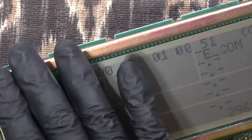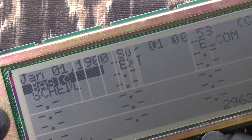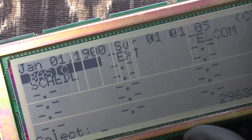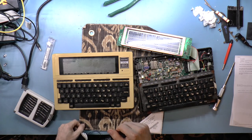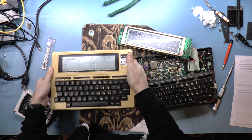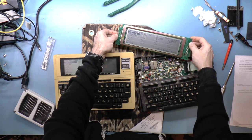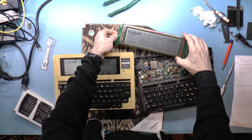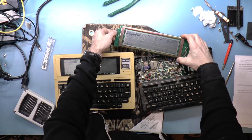Well, okay, so what I can do is remove this again, which unfortunately will cause metal fatigue, and try to line it up properly again. And this time, try to be sure that it doesn't actually move. And actually, comparing this to this working one, I can see that the Y in bytes is actually complete. So in fact, there is supposed to be an extra row, and the whole thing is supposed to move up. So this is definitely misaligned. So I'm going to have to figure out how to get it properly aligned.